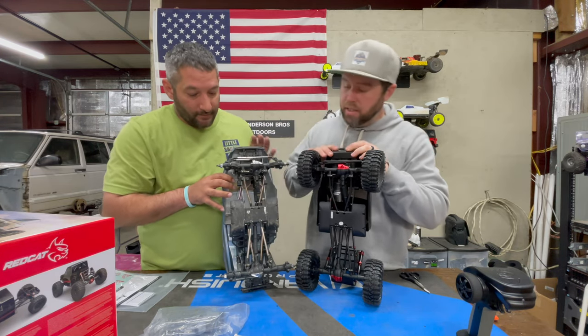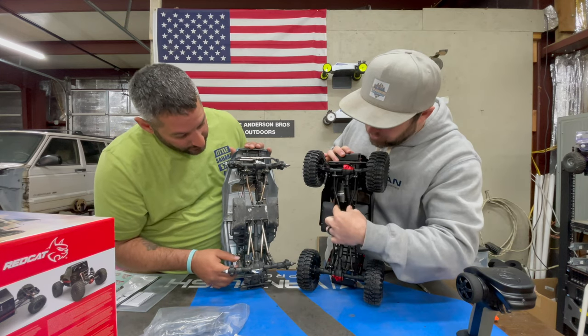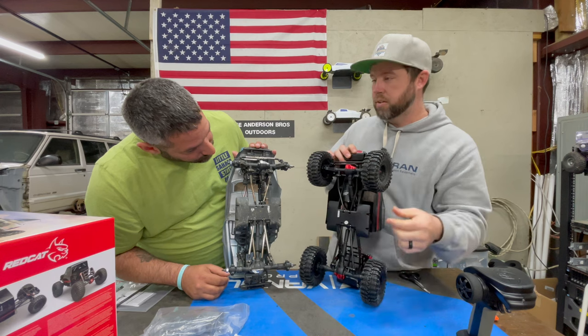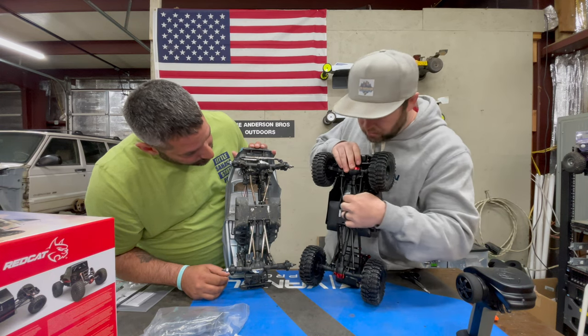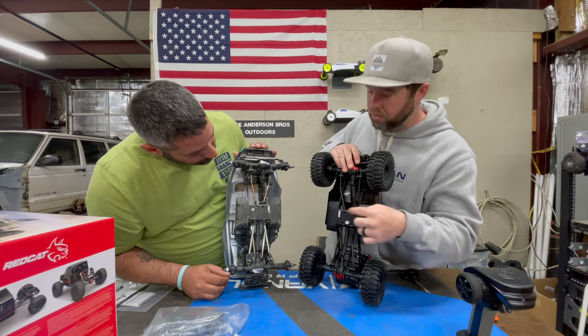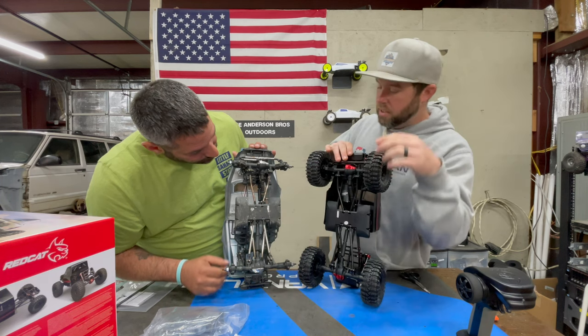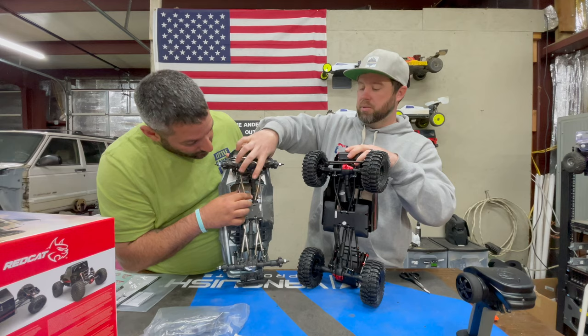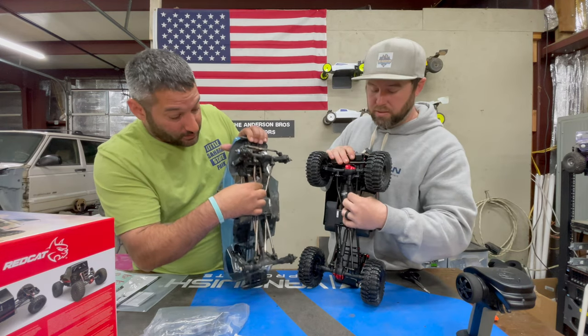You want to hold that. Yeah. There is a difference in the front. The front is now angled out. So you can see it does angle out because of, it looks like, the Fusion motor maybe and the drive shaft, so it doesn't hit. Whereas here, you can see that front link does actually come in contact with the drive shaft. So that is an improvement.